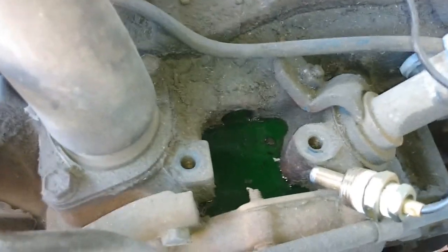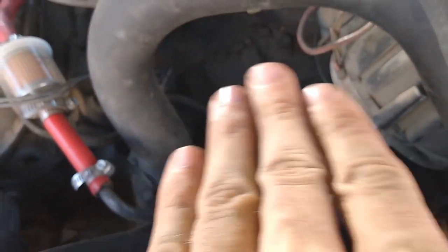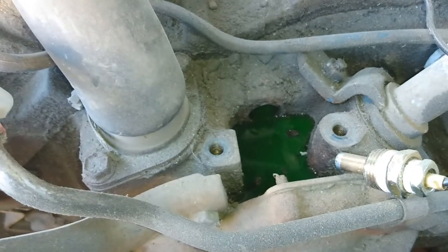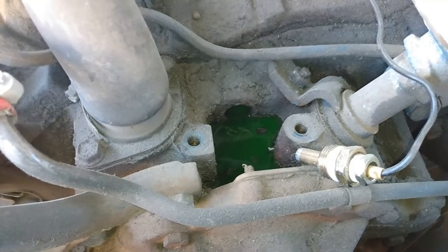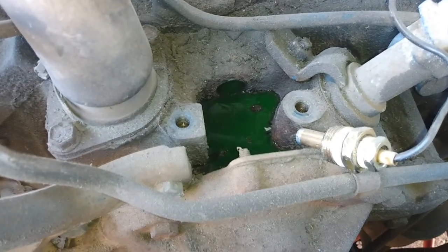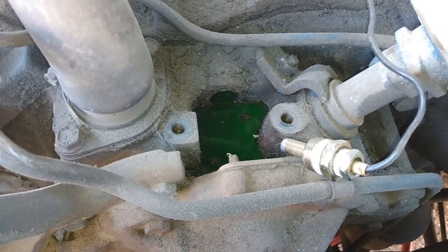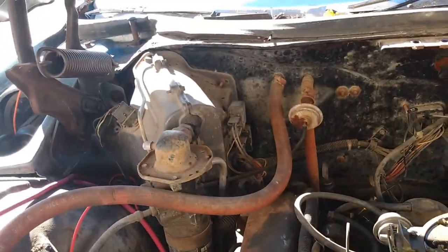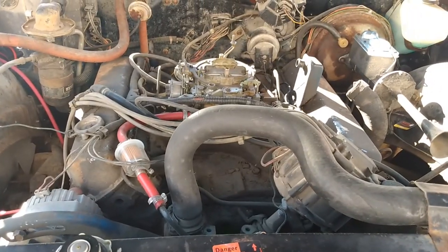There we have it, the green lake, as I often call it. That tells me that's how high the fluid is, because water or anything liquid wants to level out. So that's where the coolant is right now. So I'm gonna get some shop towels, soak that up, put the sending unit in there, and probably take another gallon or so just to go all the way up, and then fill out the top of the radiator. Let's say about another gallon.